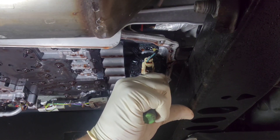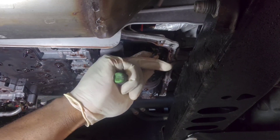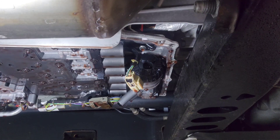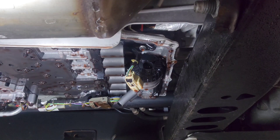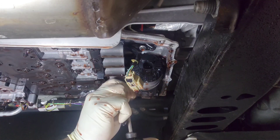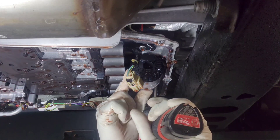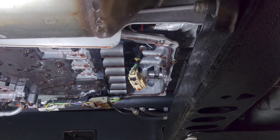I'm unplugging the fluid accumulator. The fluid accumulator's job is: when you get to a stop sign or red light, the vehicle will shut off — but it supplies fluid pressure to the transmission during that time so it's ready to start, because the fluid pump inside the transmission doesn't run unless the engine is running. So you need an accumulator that maintains pressure when the engine is off.